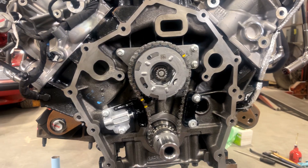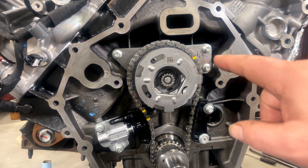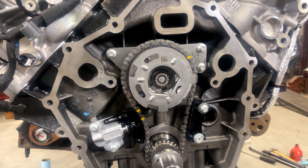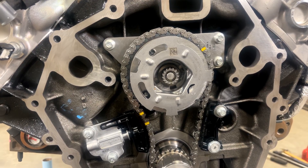Welcome back to the channel. Now, if you wondered how this phaser system works, here's what it actually does. There are little holes in the camshaft that allow oil pressure access to this, which you might be tempted to call a cam bolt, but is actually the phaser valve.